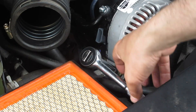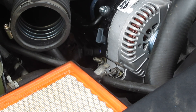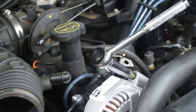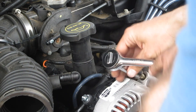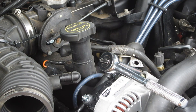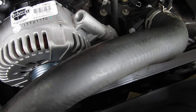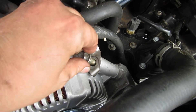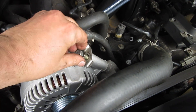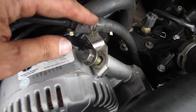We're tightening up the bolts, getting all three bolts good and tight. Then we'll put the belt on next and plug in the plugs and see how it works. Before you put that hot bolt on, remember to put this contact here that hooks up to the wire for the ground — the circuit's not going to work very well without a ground on it, there'll be no way to return the current. So get that ground connected in there first, and then you can tighten it up.